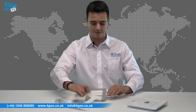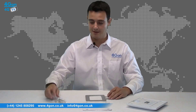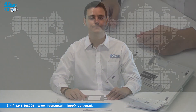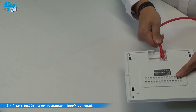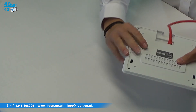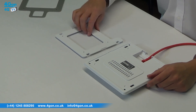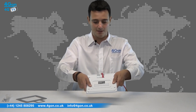To mount the UniFi, first take the metal bracket and plastic mount and securely screw to the required mounting surface using the pre-drilled holes, cables, and the supplied screws. Next, connect your ethernet cable into the UAP and route through the groove. The UniFi then slots onto the bracket. Simply slide to lock and your installation is complete.